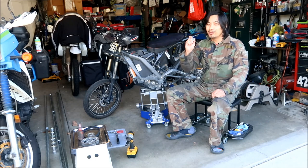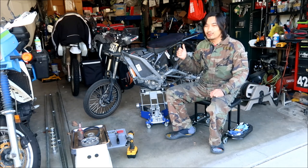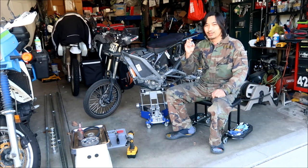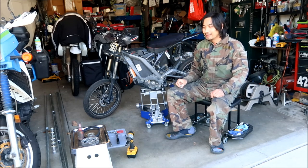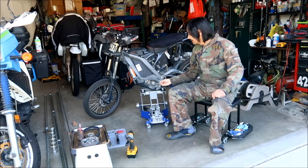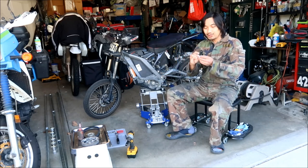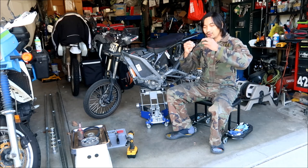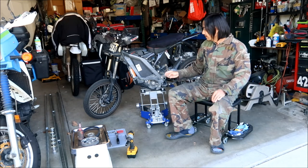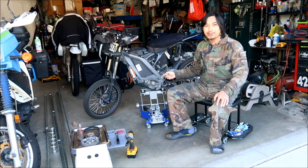I have this Honda Grom one I'm not using. I'm using the Kawasaki one right now because the Kawasaki is a 17 millimeter. This is a 19 millimeter. It's beefier, okay? So I'm gonna get some use out of this. There's no reason not to use this, because the reason I don't use it on the axle is the nut size is bigger, so it's harder to get the socket in there. I prefer the 17 for the rear, but 19 for the front, for the motor output shaft should be fine.